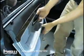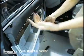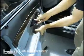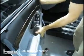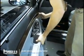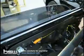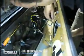Oh, nope, they came off, but I'll show you guys what I'm talking about. So the door panel is going to free itself, of course. Then we'll take the door handle and pull it, slide it through. So now that the door panel is unhooked, I'll show you all kinds of things. Lift upward and out. And now we need to unplug everything back here.